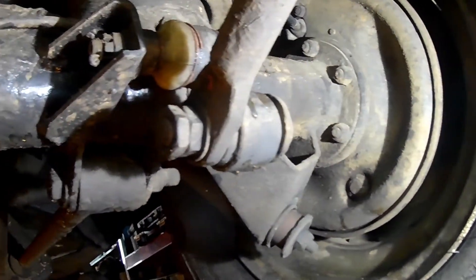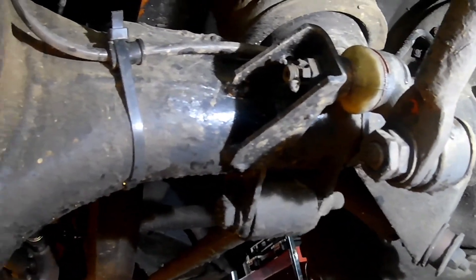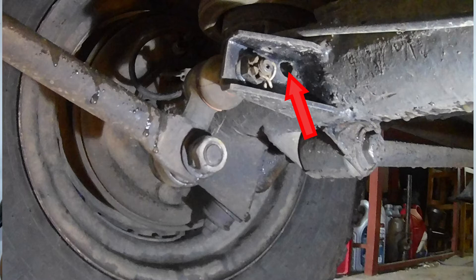The last piece of the jigsaw is to decide which SN curve to use. As I've shown, this depends on the weld details. I had a good look at the welded attachments to the axle and found them to be quite well detailed — generally welded up with double-sided fillet welds, and where the welds were completely inaccessible they used mouse holes, which is the correct approach. Having assessed all of this information, I decided that the correct curve to use was curve E from the DNV code.